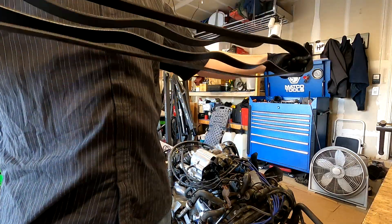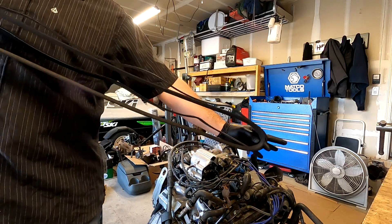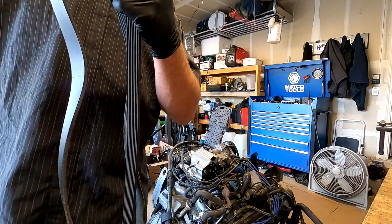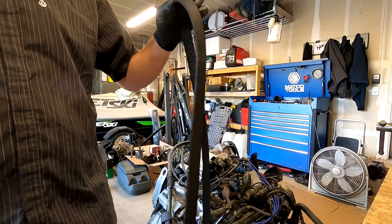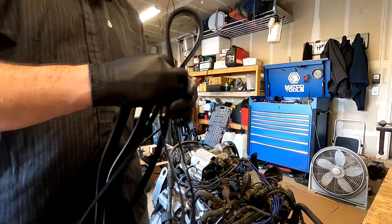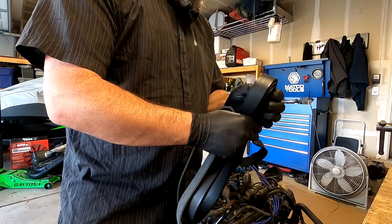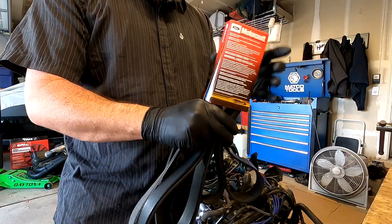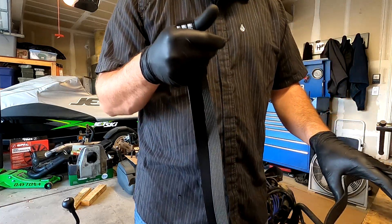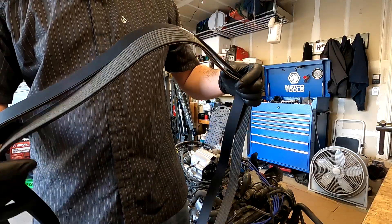This new belt - if you measure in inches it's 122.7 inches, and that's where the JK8-1227 part number for the belt sizing comes in. It's an 8-rib, 122.7-inch belt, and you can see it is going to be a little bit longer than the old one. That's where some of the confusion from Napa was coming in - they show something like a 122.3-inch belt as a replacement and it's just not going to work; it's going to be too short. You're going to have to get this belt, and I can really only find it from Ford, which is kind of funny - it's like they have a patent on the part number and nobody else can make it but Motorcraft.